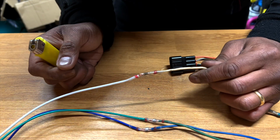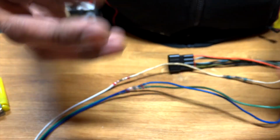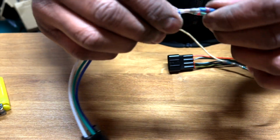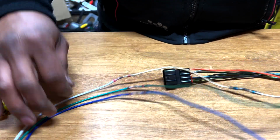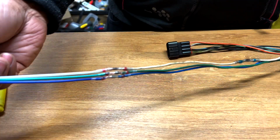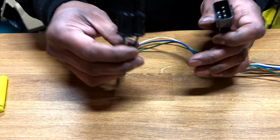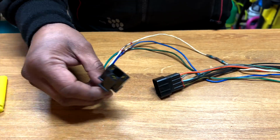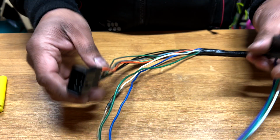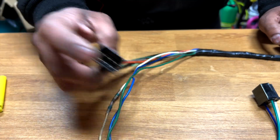Okay. So this is a really good connection because the solder will join the wires together nicely. It's with the plastic all around, so it's already sealed. And then I'm going to put a silicone tape all around it anyway, so we are good in that sense. So these are the connections. Really happy with this in terms of what I've done. Now it's just going to the bike and doing the ones on the other side.